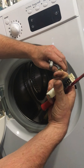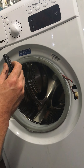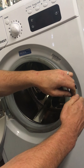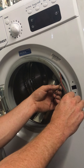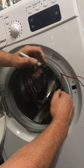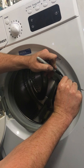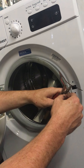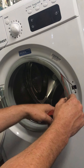The door lock is absolutely burned to a crisp. Now I've got my wires marked. I'm going to cut the wires - actually the burnt ones will just pull out. So this is number four, this is number three, and this is number two. I'm going to pare back this wire because it's all burnt. I'm putting in four new marks a bit higher so they don't rub off - and I know this is three, the second brown one, and obviously two for the red. Make sure the machine is plugged out, then cut the wire back here and take off the burnt bits.